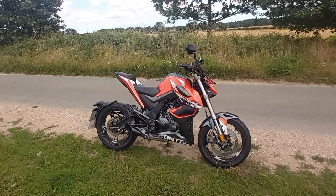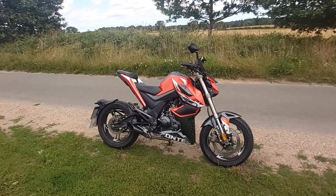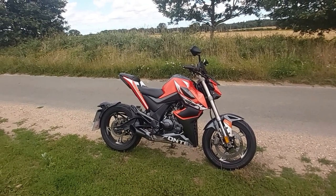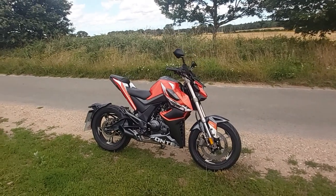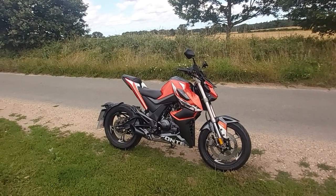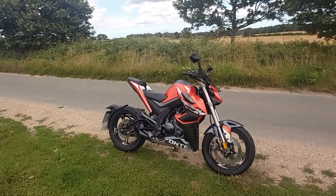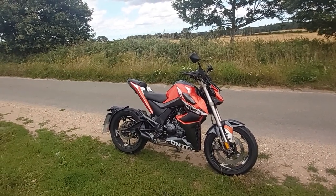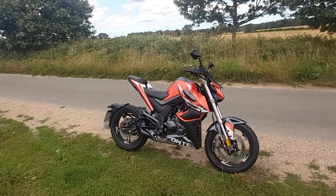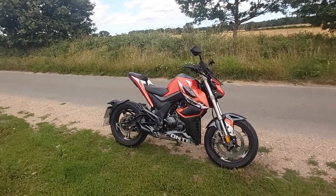BR-1225 is what's in them when you buy the bike. They last about six or seven months before the bike says low battery. You can then use a BR or CR. I'm using CR ones because I didn't want to spend £6 when I wasn't sure it was the battery — I just bought two blister packs for about £2 off Amazon. Put it in — yep, definitely that. Once I use all these batteries up, I'll then buy a proper Panasonic one. It's not a fault, it's just the battery running down.